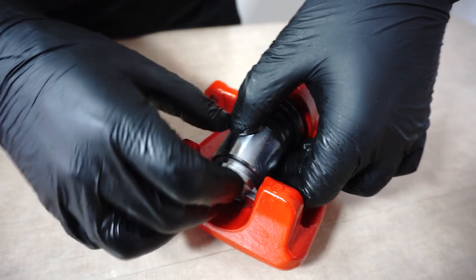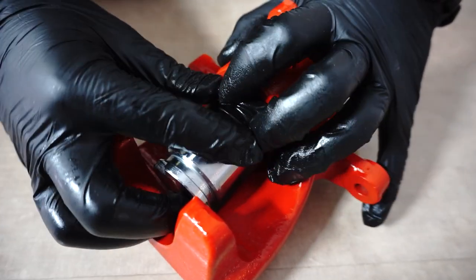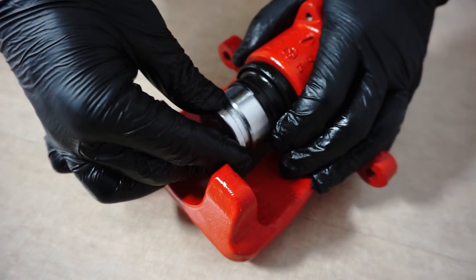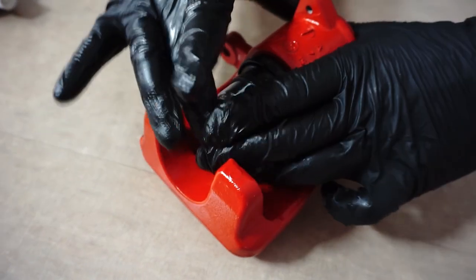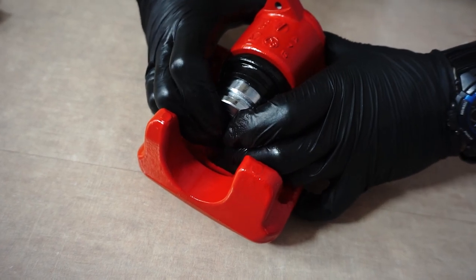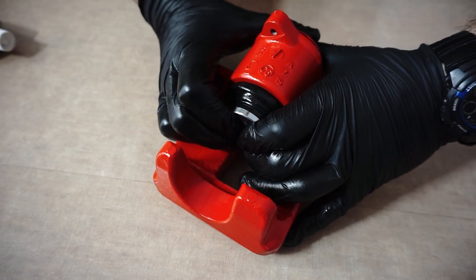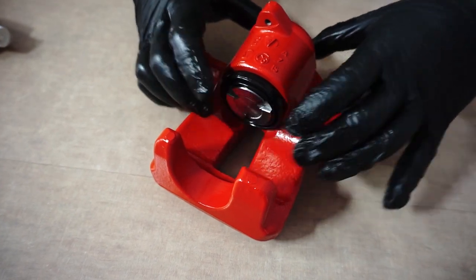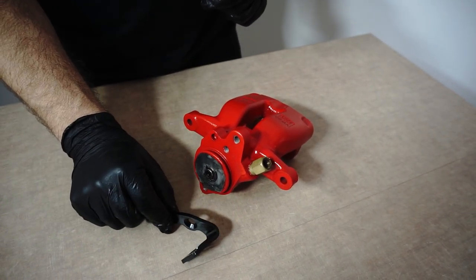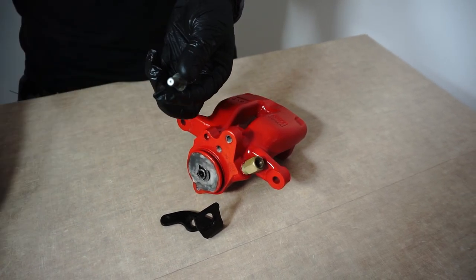Hold the piston and gently place the dust cover end in the groove in the brake caliper. Now we should be able to slide the piston all the way with our hands. If we run into problems at the beginning, you need to turn the piston to match its inner shape with the internal handbrake mechanism shape. Install the brake hose bracket, it's been painted black already, add medium strength thread locker to that bolt and tighten it.